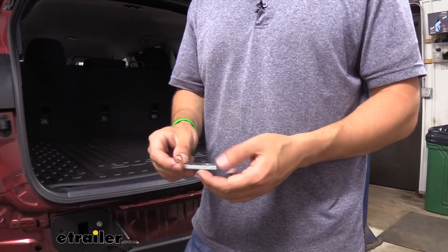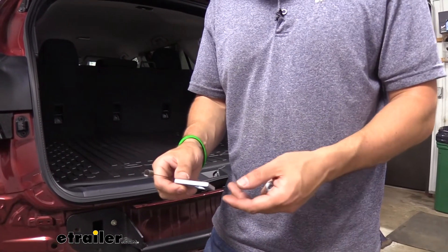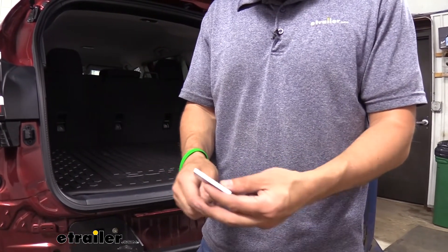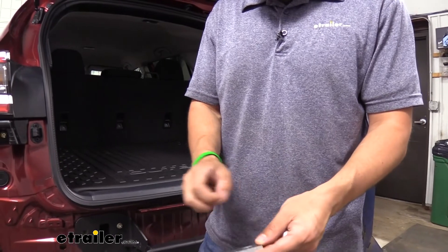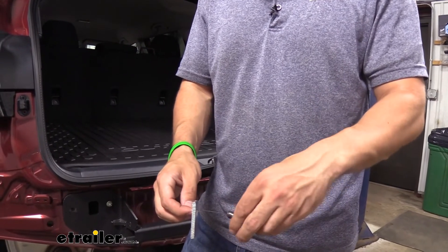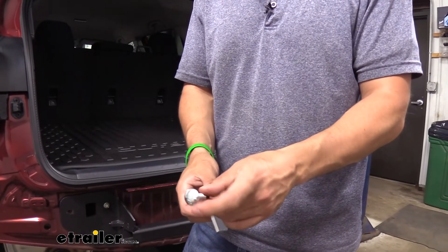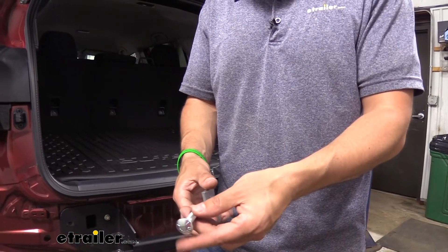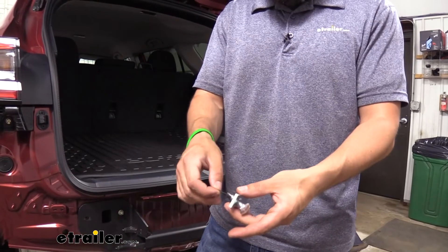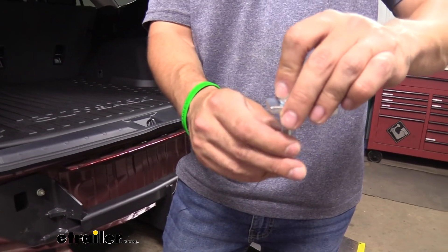Another common fishwire technique that's used a lot is called reverse fishwire. It's sort of similar to what we just showed you, but with reverse fishwire there's only one hole and that's your attachment hole. What you're going to do is first take your fishwire, the coiled end, and place your spacer block over the fishwire like so. Then you're actually going to thread on your carriage bolt — doing all this outside of the hole. Then you're going to take the head of the carriage bolt, stick that up through your attachment hole, shove that into the frame, followed by your carriage bolt. Pull both of them down through the hole, and this is how it should sit inside the frame of the vehicle. Then you'll simply unscrew your fishwire.